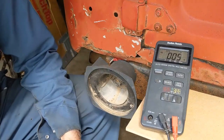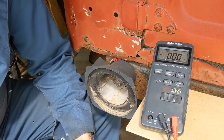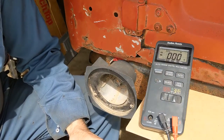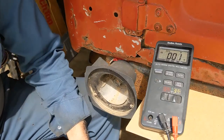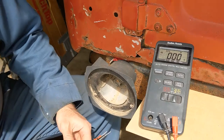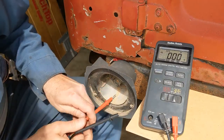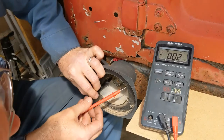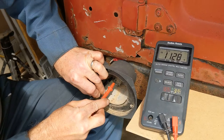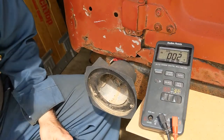In a video I did last week, we did a walk around of the electrical system and a couple of viewers noticed and commented on the low voltage I'd mentioned. I thought I'd show you — maybe that'll be our project for today — to work on that and try to figure out what the source of that problem is. I've set up to do the same thing I did last week: I've taken the light bulb out of the rear running light, it's turned on right now, and I'm going to go ahead and measure the voltage. You can see 11.29, 11.28 volts — that's too low.